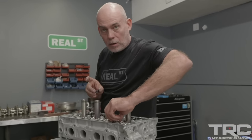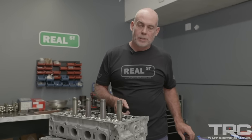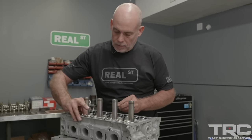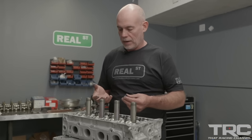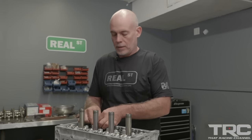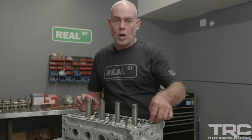For those of you that noticed the color of these studs versus the regular ARP black hardware or the 625 hardware, which has a silver color, this is an L19 material. And while it's a strong material, it does not do well with moisture or water. So you would never use an L19 stud on an engine where the stud goes into a water jacket. And if you do clean them with anything, or if your hands are wet, you want to get the water off the stud. It actually causes hydrogen embrittlement, which, as crazy as it sounds, means the fastener will quickly deteriorate and or break. So if you're working with L19 material like this Speed Factory kit, you want to be careful with how you handle it. You won't be able to get away with handling it like the rest of the hardware on the engine.